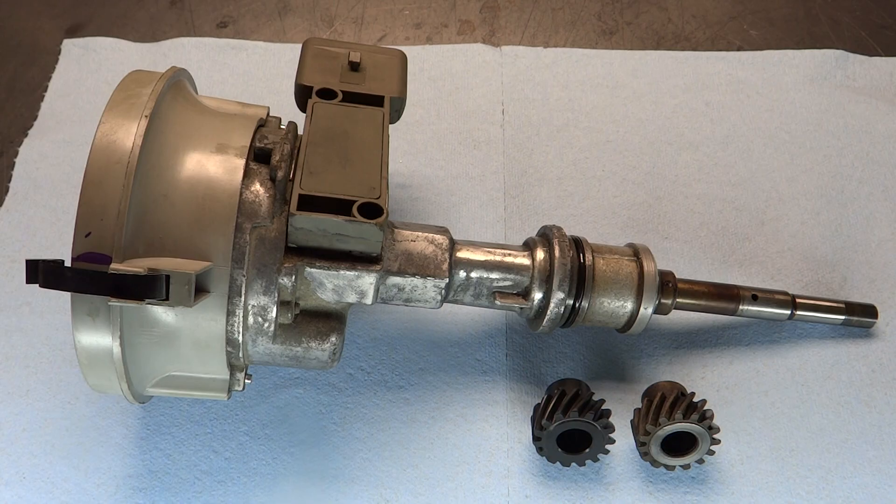The reason there could be some merit to that is that, in general, a flat tappet camshaft is made out of an iron casting. And typically, from what I've seen, roller cams are often machined out of a steel billet. I think that the non-HO roller cam I put into the budget Ford 302 was a steel camshaft. And I put this distributor in without really thinking about the fact that I was taking out a flat tappet cam and installing a roller cam, and that those two camshafts were probably made out of different materials. So I thought I would do a very high-level overview of what I've read about different camshaft materials and the distributor gear materials you can use with them.